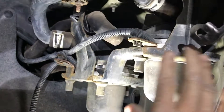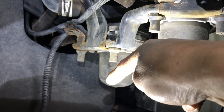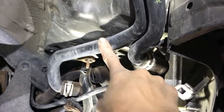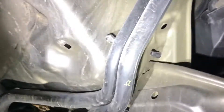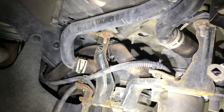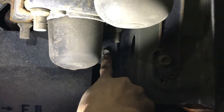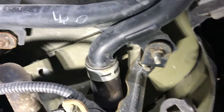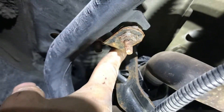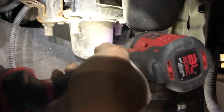Both pumps are mounted in a bracket facing down, so we can't just unscrew a bolt or nut to take the pump down without taking the whole bracket. The pump inlet pipe is also right there. We have to take down the whole assembly, which is held to the frame with two bolts and two nuts at the top — all size 12mm socket.